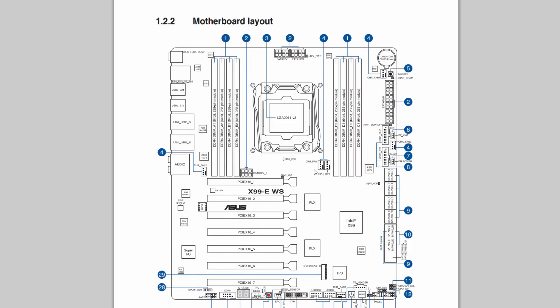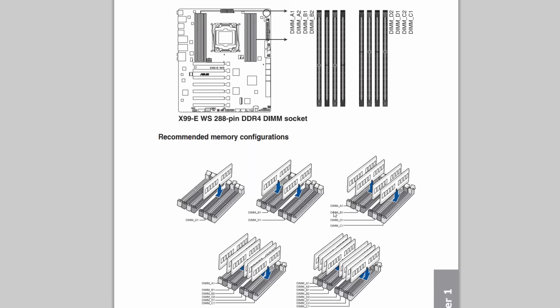This is a typical manual shadow diagram, which gives you the major components and connectors on a motherboard. This is something you need to understand, and as you download different motherboard manuals you can compare them. This is often a graphic used in the CompTIA exam for you to identify things like RAM, PCI slots, PCI Express, AGP, IDE connectors. You're expected to look at a shadow diagram and identify major components such as Southbridge, Northbridge, the CPU, and the DIMM slots.